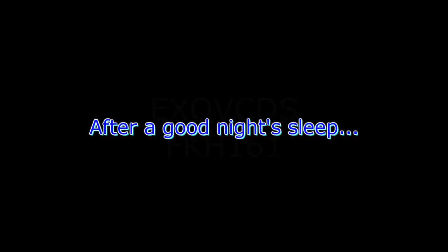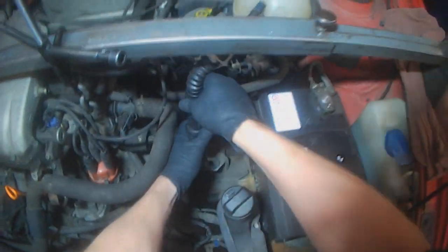Oh, gotta disconnect the clutch cable. So with it connected still right now, what I do is I use a pry bar, wedge it against here, lift up on the arm. At the same time, the cable's gonna collapse. So we pretty much need to hold it down somehow. I'll still be able to take it out. There we go. Okay, rest tomorrow morning. Another day, another dollar.